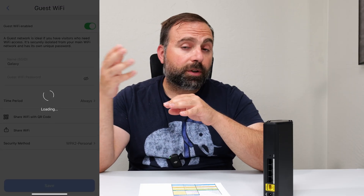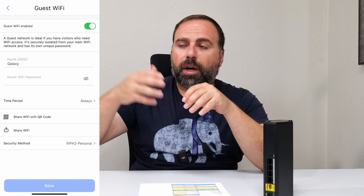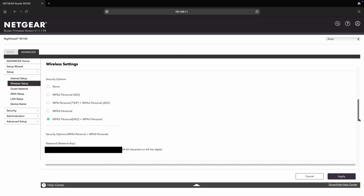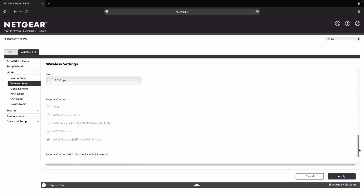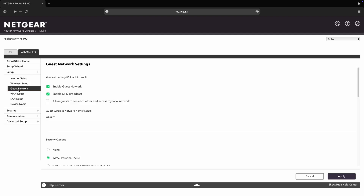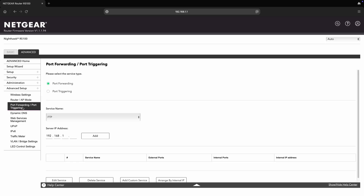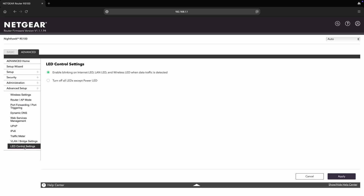The app also offers a free 30-day trial of Netgear Armor, which provides additional protections. It's completely optional, but if you like it, there is a subscription available. If you want access to more advanced options, you go to the web interface — type in the default gateway IP address, 192.168.1.1, log in with the username and password you set during setup, and you get a lot more options. You can change your Wi-Fi name, adjust speeds, manage guest Wi-Fi, change your DHCP, set up a VLAN, manage firmware updates, save or reload settings, and set it up in access point mode.